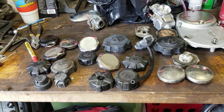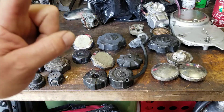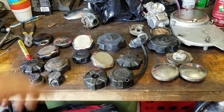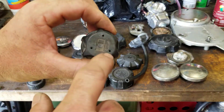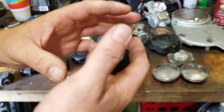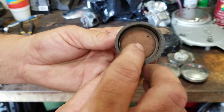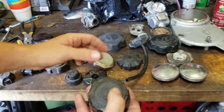All these caps have something in common — that's why there's a variety of them. Every single cap you see here has one absolute certainty: they all have a vent. On a Briggs and Stratton three-and-a-half horsepower, these are the vent holes. On a Tecumseh, these are the vent holes. Grab your caps and take a look — there's a hole there, there's a hole there. Check them out.